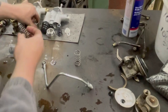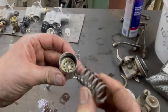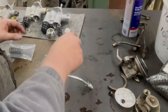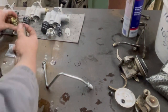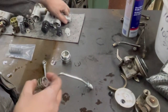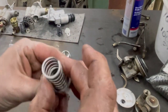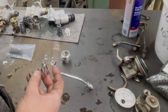Inside the pump, the smaller spring doesn't sit in there very well — it just sits on top of the cap rather than where it's supposed to. The larger spring sits where it's supposed to. This spring is designed to go with this pump. The other one fits inside here like it's supposed to. Since these are both big bore pumps, the spring fit really matters and I just wanted to mention that.